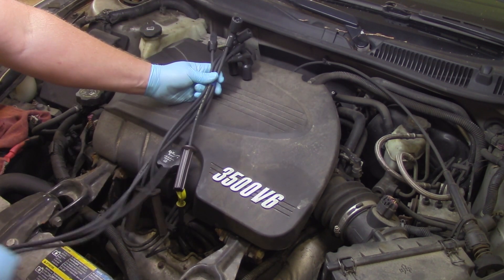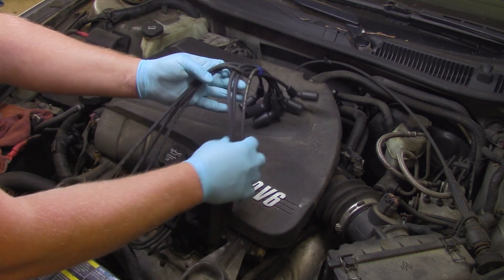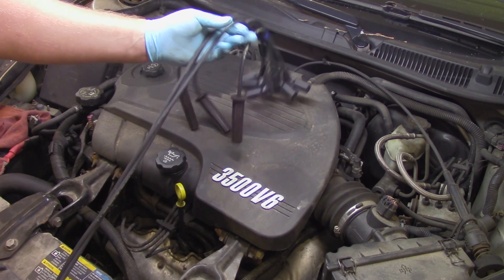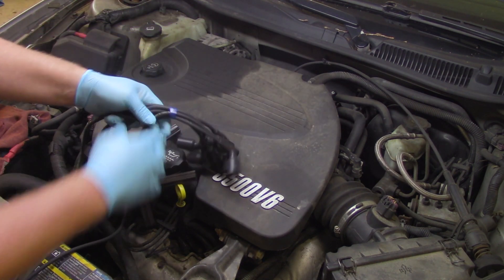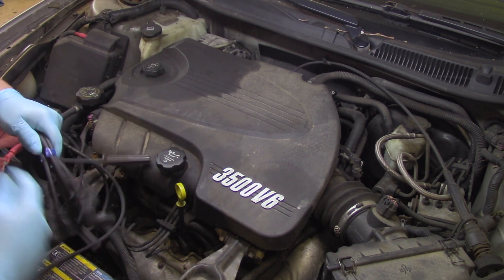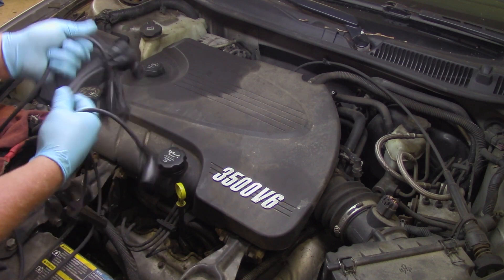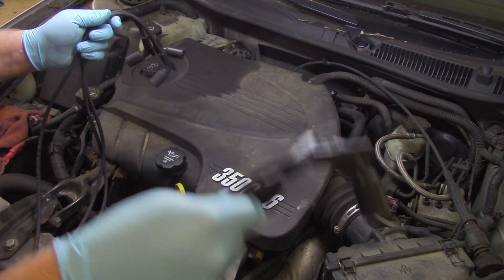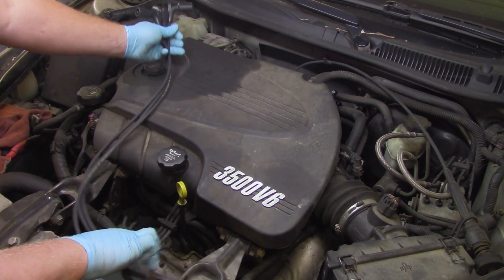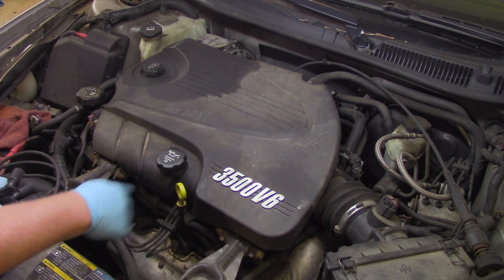I've got my set of wires here, laid out and packaged so the short ones are for the back side of the engine and the long ones go toward the front. They're already separated and held together with a little tape. Use a pick, knife, or scissors to carefully separate them — we don't want to poke them. Even among the long ones, each will be a unique length, so I'm setting aside the longest one for cylinder number two, which has the longest reach.